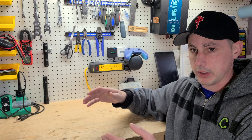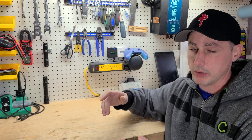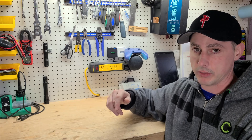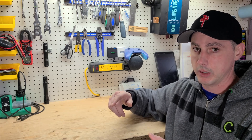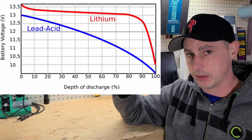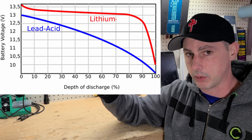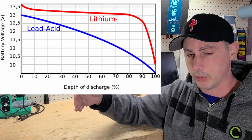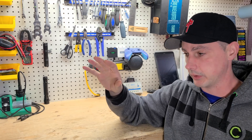How you'd want to store them is to bring them in — with lithium iron phosphate especially, you're going to want to discharge them and track your discharging to get to 50 percent state of charge. If you look at the discharge curve of a lithium iron phosphate versus lead acid, there is a very steady line across the voltage and then it drops off when it's dead. So if you're just trying to figure it out by voltage, you won't be able to.